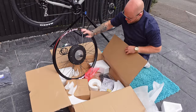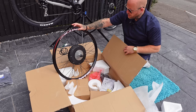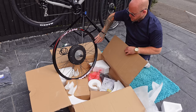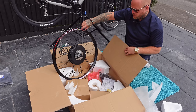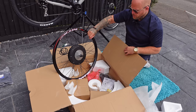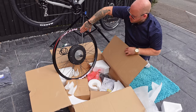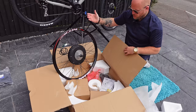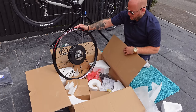This is the upgraded MTX rim - I think it's a double walled rim so it's a bit stronger than the standard one, and the rim is all in black which I much prefer. Things to bear in mind: if you have the standard wheel it's got a silver and black rim and works with any type of brakes. But the MTX wheel, because it's got a chamfered beveled edge, doesn't work with V brakes - which to be honest you don't really want with a 2000 watt kit anyway because it's not going to have enough stopping power.